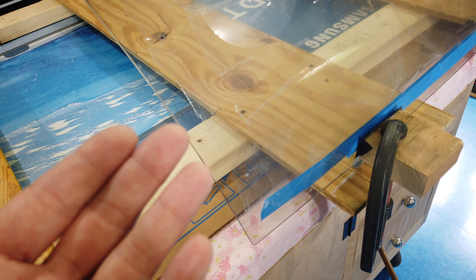After the plexiglass countersinking and final hole sizing are done, I'll come over here and center-punch all these little marks, then do my usual drilling and tap them for the screws. At that point I'll put the canopy back onto the airplane, temporarily run the screws through to see how everything looks - at least this back half will be locked in place. I'll tape the front again just to keep it from wandering, and then I'll start laying out the holes along the side. That's the plan.